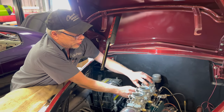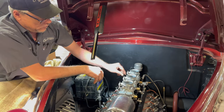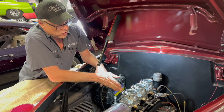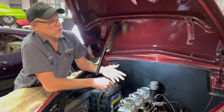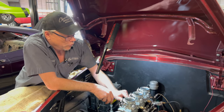Exactly. You got to know your car, how much fuel it wants when it's cold. And it'll be consistent, more or less. It will tell you pretty quickly. If it starts blubbering when you have the choke pulled all the way out, which is closing the chokes, and you start to push it in and you can hear the RPM start to come up, then you know you've got it over-choked. Okay, all right. It's knowing your car and what it's asking for.